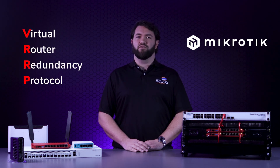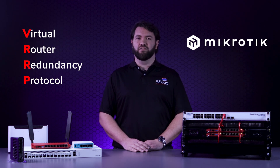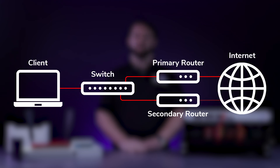This protocol allows you to have two routers configured with similar settings, in which case the secondary router can take over when the primary router fails. This change is automatic and doesn't require any physical intervention. To picture it, you have the two routers cabled to the same network switch. The VRRP interface is the virtual link between the routers and the switch and is recognized as the gateway to the LAN network.